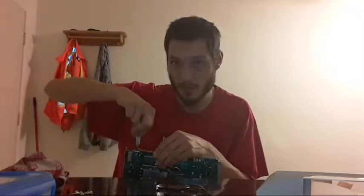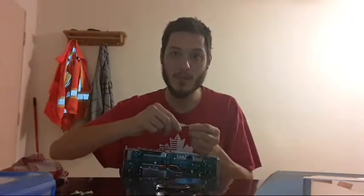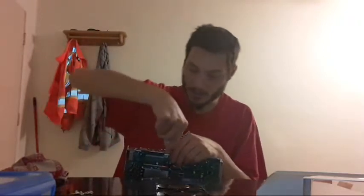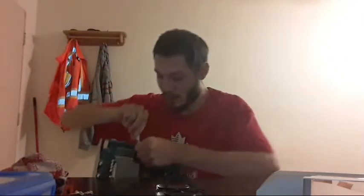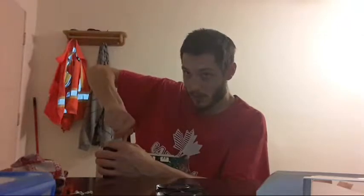I really want to play Xbox. When the Xbox decides to die on you and just keeps red ringing over and over, eventually you end up using that console for parts — because you get tired of fixing the same problem over and over. But in this case, I'm pretty sure it's as simple as bad solder to the video RAM underneath and bad solder underneath the GPU and video processor, because it had all those other red rings.